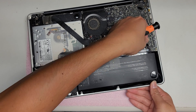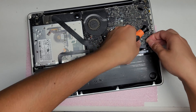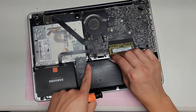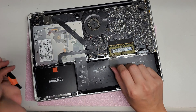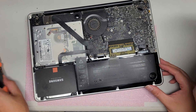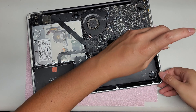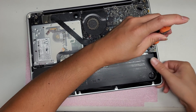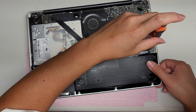It's just a tri-wing — they have different sizes and they will work. When the battery is bulged like this, it's probably destroyed the screws anyway. Actually, the screw is still holding itself — that's pretty crazy. You will have to remove that one screw. It finally snapped off, but we'll remove the screw. Keep in mind these tri-wing screws are different sizes as well.